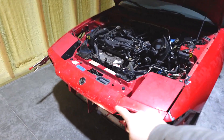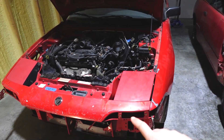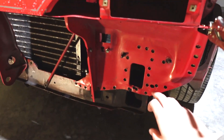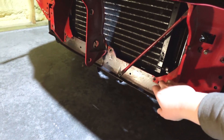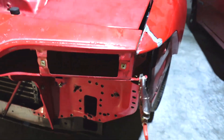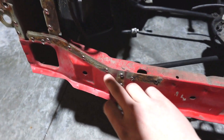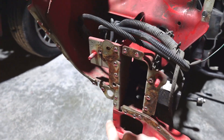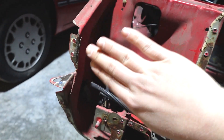Before I can get this final position figured out kind of side to side, I want to do some surface prep on the actual car side. Everywhere that these spot welds were drilled out, there's actually like some raised parts behind it — it's not perfectly flat and smooth. It's easier to see on the donor car — when I cut everything off it kind of left these little donuts everywhere where the old spot welds used to be. So what I want to do is kind of just grind those flush so it's just a flat sheet of metal again.